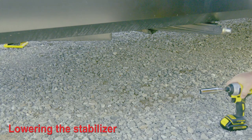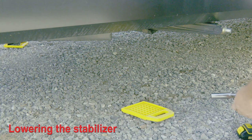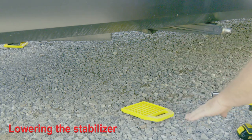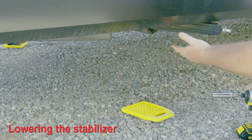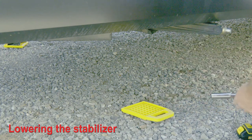Make sure the camper's level. Stick down your pad here. You don't want to extend the jacks out too far. If you've got quite a distance from the camper to the ground, we've also got some two-by wood planks in there you can use to raise it up.